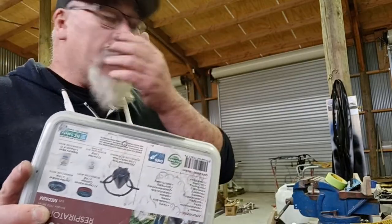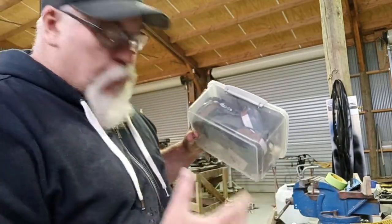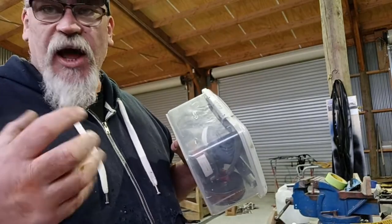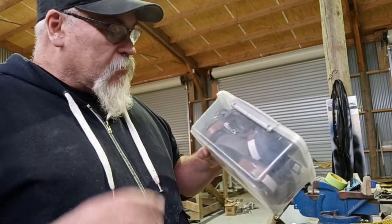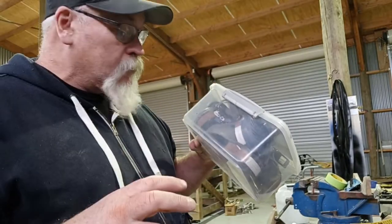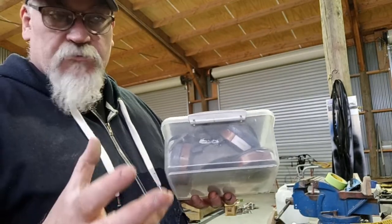And the reason why, we've got a video on it, and I might link it in this video, is these filters for two-pack spray paints and stuff like that, because the hardener in it is really bad for your lungs. What happens is it gets into your lungs and it hardens up, and over time you basically can't breathe. So these filters have only got a certain spraying or breathing time, about 8 hours is all I've got. So when you're not using them, if you leave them out,